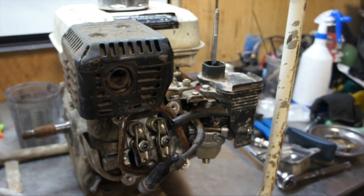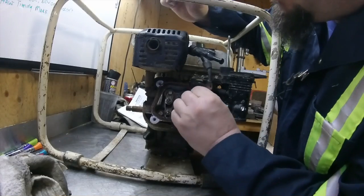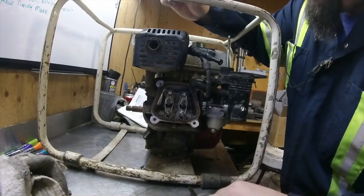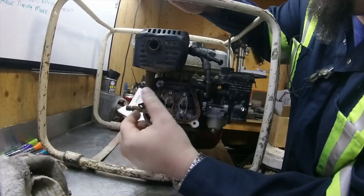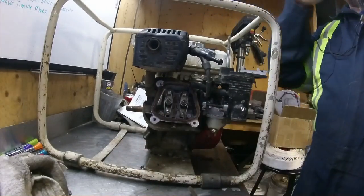It's pretty loose — well, maybe not. The intake is supposed to be 0.006 and we fit in there. It might be a little on the snug side, but the exhaust is 0.008 — same thing, it fits in there. It just felt loose, so okay, that part's done.